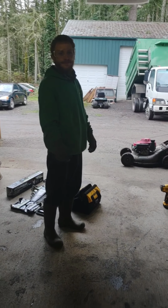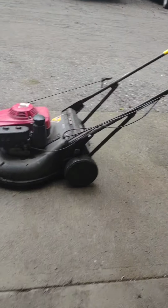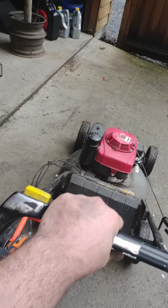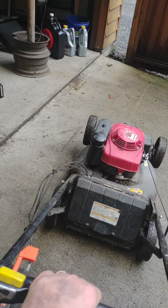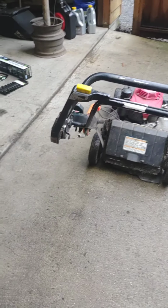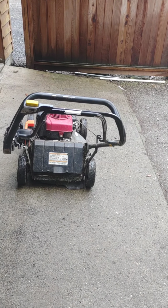And like Josh just said a minute ago, if you ever notice on a Honda, if you could pull back on both of these, it's just a quick check here when you're doing this. But if you can go forward and you can hear it click, and then you can pull back and it locks up both wheels versus free wheels on one wheel, that means that both of those ratchets are working correctly and the pins aren't broken and the ratchet assemblies aren't collapsed.